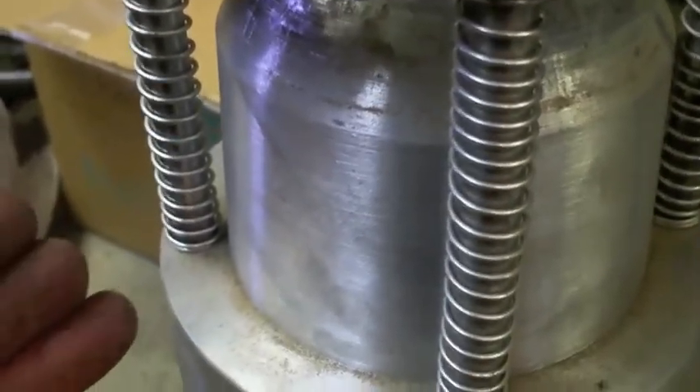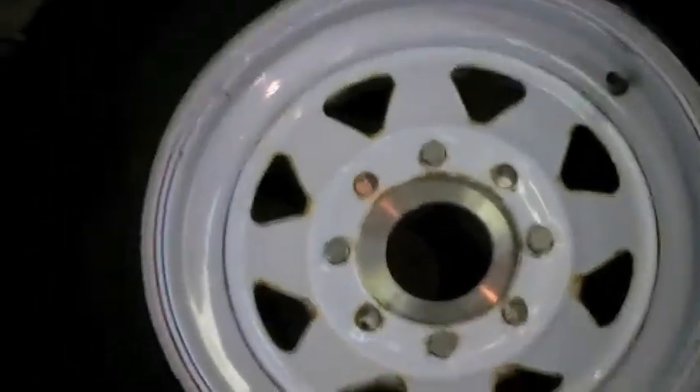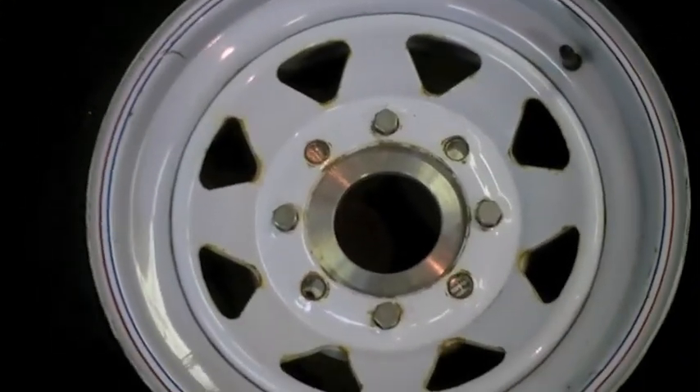I don't like to see that cut — I can cut my own tires, thank you very much. I'm going to balance them here. I know it's the very worst kind of tire balance but it's what they used to do. It's a Harbor Freight unit, and my father machined brand new sleeves and cut them to a much finer tolerance — it took the side-to-side slop out of the unit. In theory the spindle board shouldn't really matter since it balances up top, but we found it mattered a little. Because the center holes are so big I have to use that ring, which adds another whole level of potential misalignment.